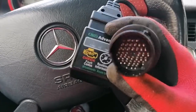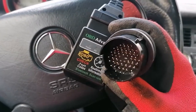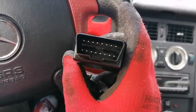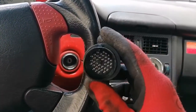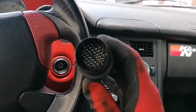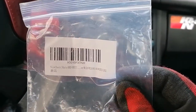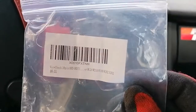The annoying thing is this version of the car does not have a standard OBD port. The standard port looks exactly like the scanner I have here — that's the male side, and the female side is on the adapter cable. If you turn the adapter cable around, you can see there are special pins in there, which is a Mercedes connection. It's not even a standard OBD1 — I went out and bought an OBD1 cable thinking that was the right thing, but it is not. This is a special Mercedes connection — specifically a 38-pin OBD converter for Mercedes, so make sure you don't order the wrong one.